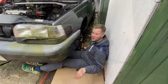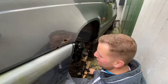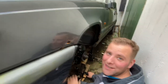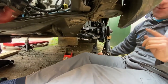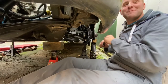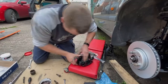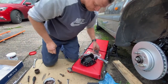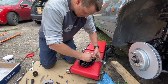To elaborate on what John covered earlier: you've jacked the bottom of the hub to get the wishbone level so you don't put torque into the elastomeric. You put it neutral so if it goes up and down it's got the maximum range of flexibility. Failure to do this could result in it tearing apart — you never want to tear a bush.